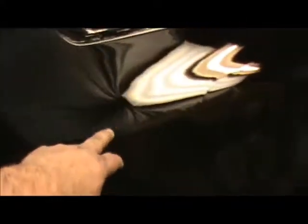The fenders came out well. Nose. This door here, unfortunately, the wind came down, knocked a cup down that was on the shelf here, hit the water, and I got water marks in there. But I put extra clear, hopefully that all wets in out. And once again, I'm consistent. Got runs on the rear quarter here, no big deal, wet sand them out. Other than that, I'm pretty happy with the way it looks.